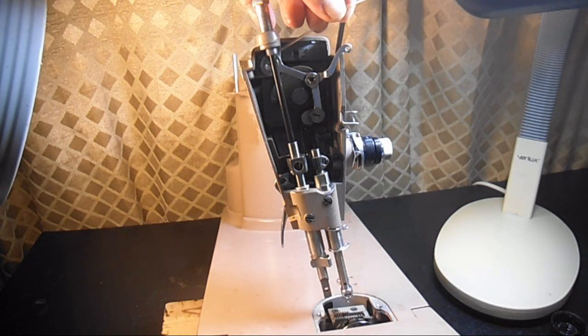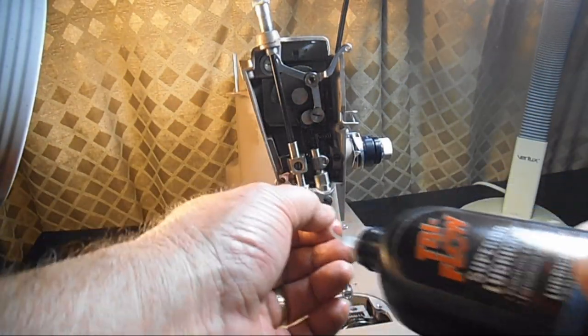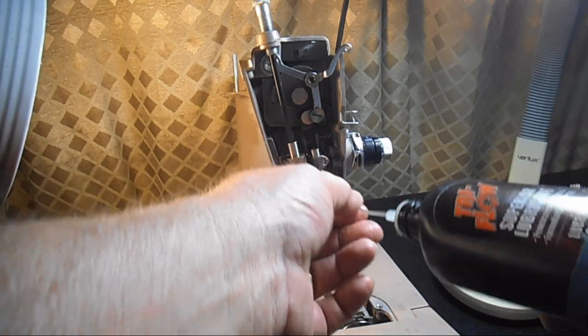This has been a very successful technique — this whole pre-treat, wash, dry, and oil has been very good to me over the years. We're also going to come down and put a coat of oil on the needle holder, presser bar bushing, bearing, thread cutter. Put that needle bar up and a little bit up here on the top of the presser bar bushing. You can see I'm overdoing it a bit, but we'll get all that excess out of there. It's okay — you don't want to leave it this over-oiled, because it's going to create tension problems.